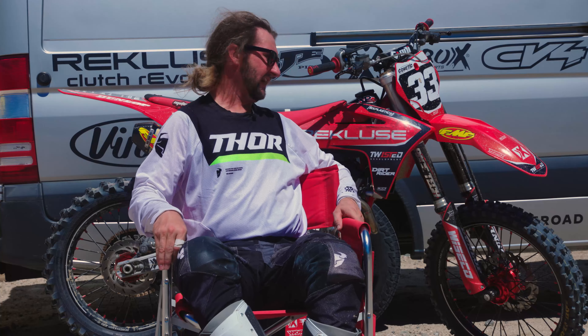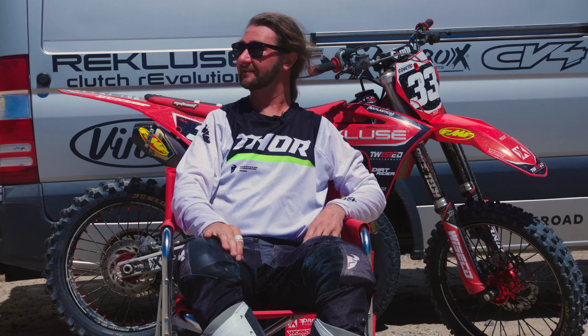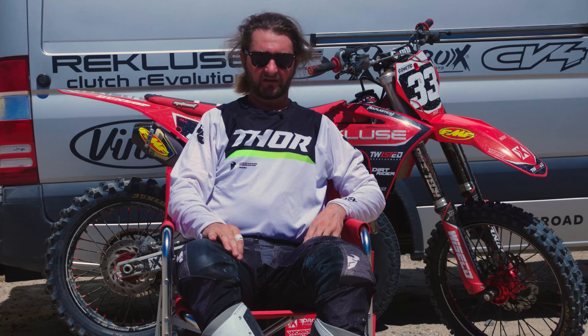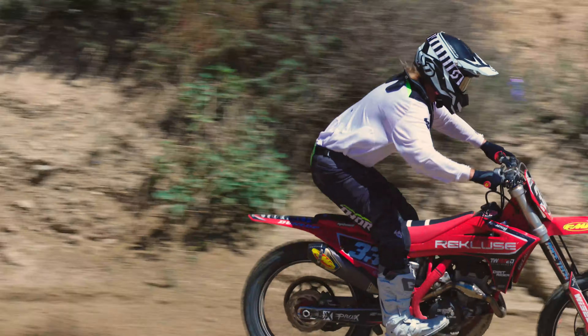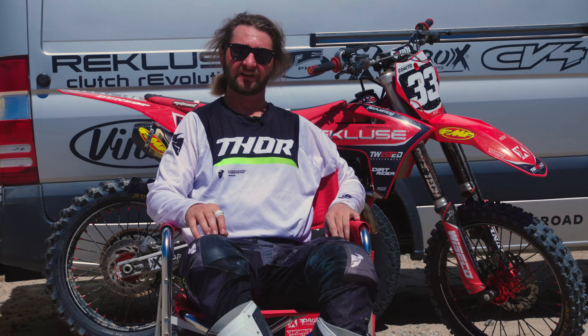All right, we are back — just got in from spinning some laps on the main track, GoPro footage and everything. Nice hot September day. The bike is not like stock at all. The MC250 has a lot of rev in stock form and a lot of soft bottom. Jay's bike with the FMF pipe, meaty back tire, and one up on the sprocket — it pulls so good. Jamie at Twisted did a great job on the ECU. There's no loss in overrev, but the bottom end is cleaner, it picks up, and it starts good. There's a lot more tunability with that ignition — that's the biggest thing.